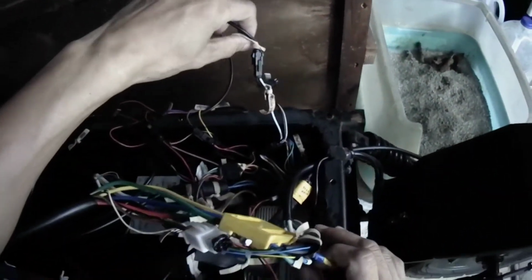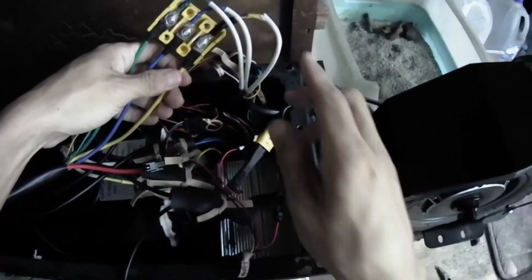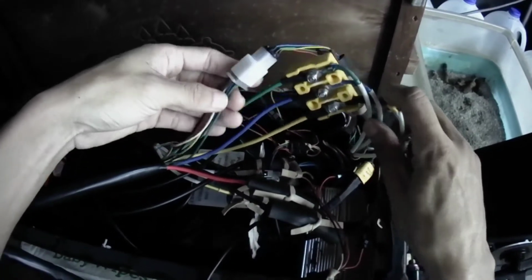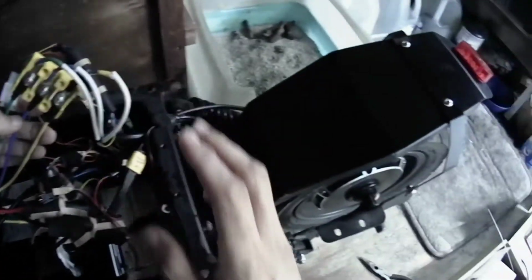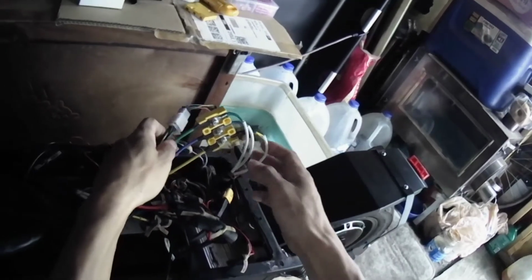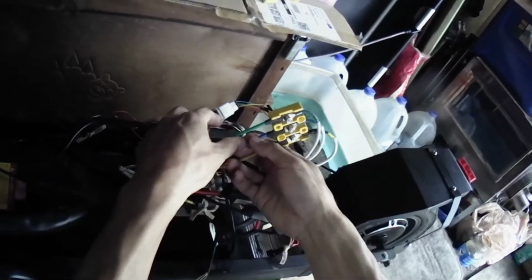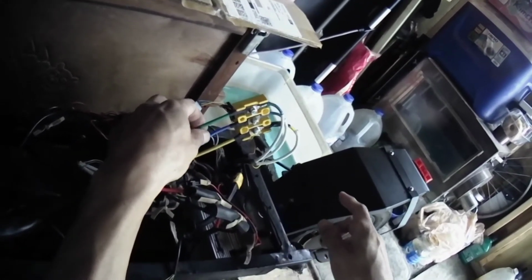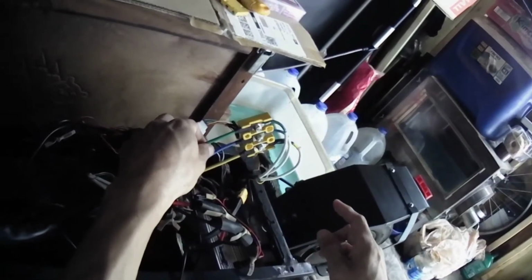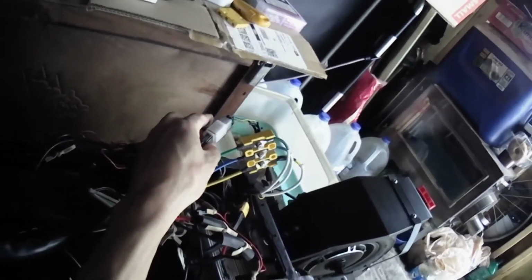For the motor to work, to turn, you need throttle display connected. You need phase wires, 3 phase wires, and Hall sensor wires. They are usually 5 to 6 wires. By default, they come with the motor. When you buy a motor, it comes with these wires. These 3 thick wires are phase wires, connector wires that power your motor and also send signal for your throttle level. So you have a throttle control. When you press throttle all the way, it spins at maximum power.